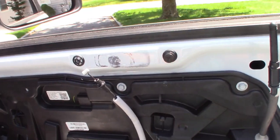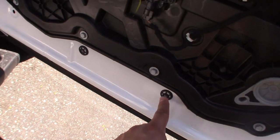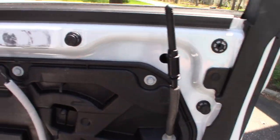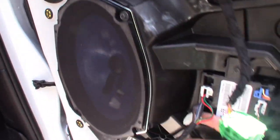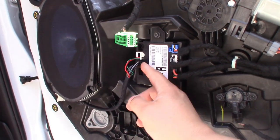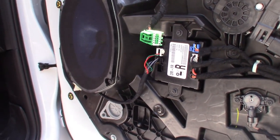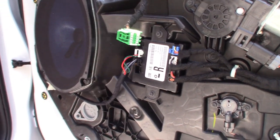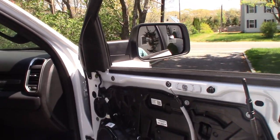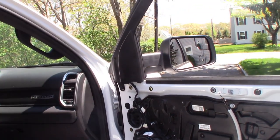Some of the connectors and clips actually stay in here — see how this one stayed in there? It's supposed to all come out. Some completely came out so we take that, pry it off, and push it back in. This one stayed in as well — same situation. You have this whole harness that comes down; this is the harness here, B and C. They're color-coded — you can't put the white and the black or crisscross B and C. Hopefully all the convenience lights and signal lights work, because they say everything needs to be programmed by Chrysler.